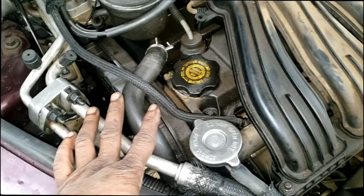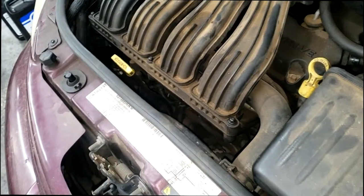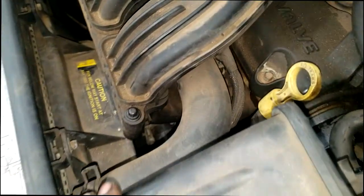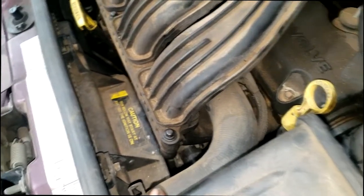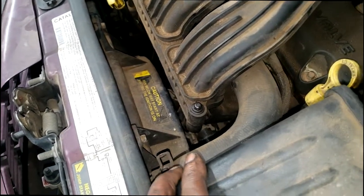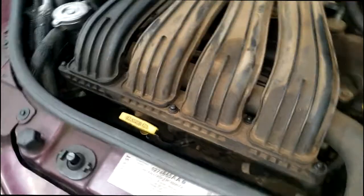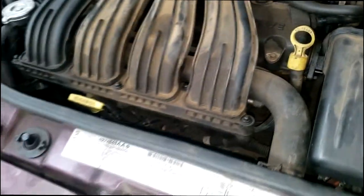But a car can't live on high speed fan alone. The high speed fan motor is working — it's just the low speed fan that's burned out. The low speed fan is the one that gets the most work; it runs all the time, keeping AC pressure down and keeping the car from overheating. The high speed fan hardly gets any work — if the high speed fan comes on, you have problems. If everything is doing its job, there shouldn't be a need for high speed fan.